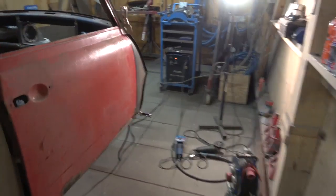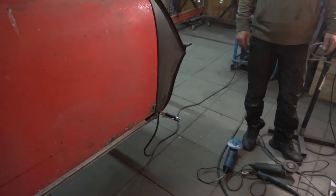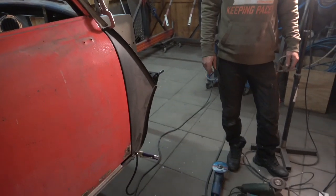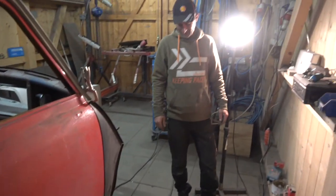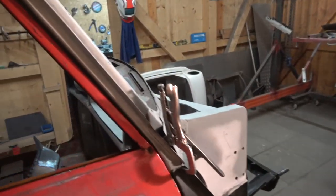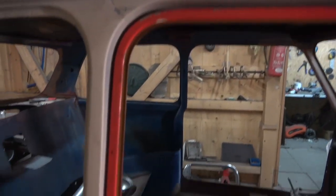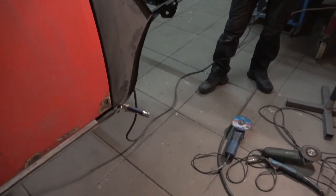This is typical of Minis - the Mini just has this door on. We're going to take the skin off and we've got two new skins so we'll reskin both doors. That's the track car - he's put this door up with second-hand edges, put the new A-panel in and it fits unbelievably perfectly. Typical - because it's a track day car it fits with virtually no fettling to do. All the way around it's perfect. If this was a road car it'd be an absolute bugger and we'd have to fettle it, but it's always the way.